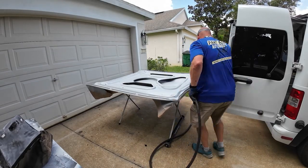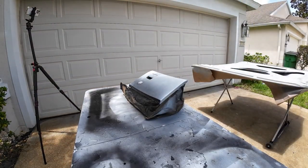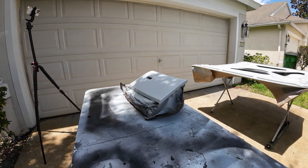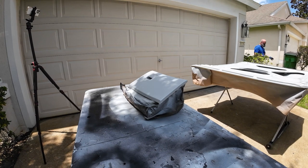For the hood, this is me shooting the primer. I wanted to let you see what it looks like. This is after I've already put the epoxy primer down — this is the 2K primer, so you can sand it all nice and smooth. I went around everything with 600 grit to make it nice and smooth, because as you spray layers you get more and more texture with each layer, so you want to keep all that texture down as low as possible.